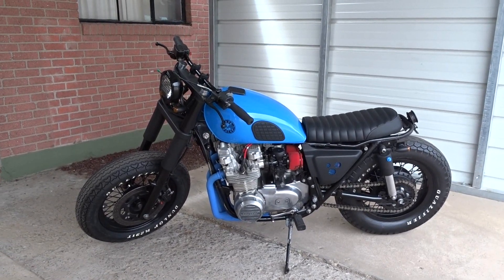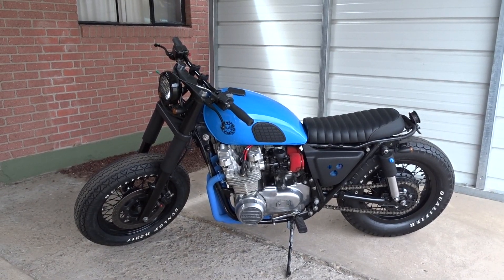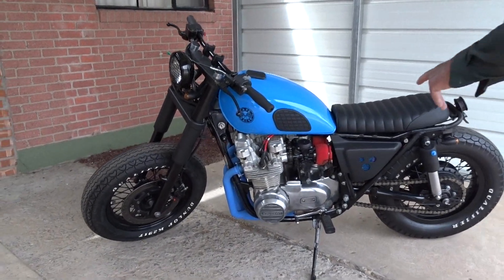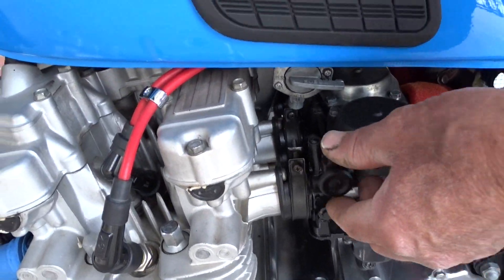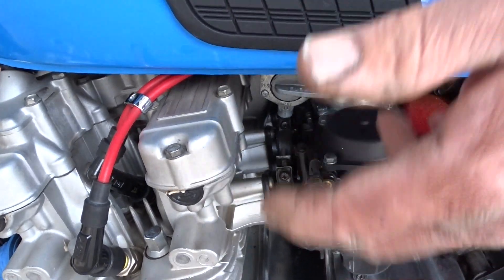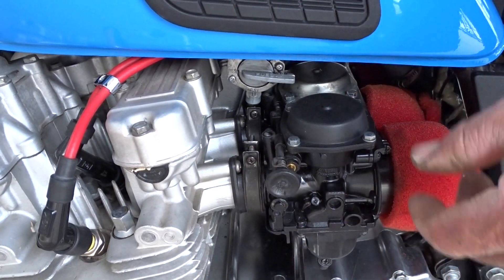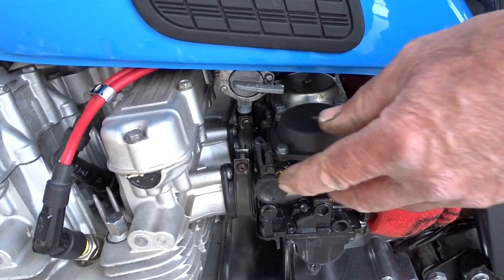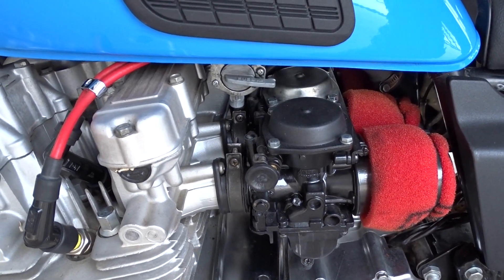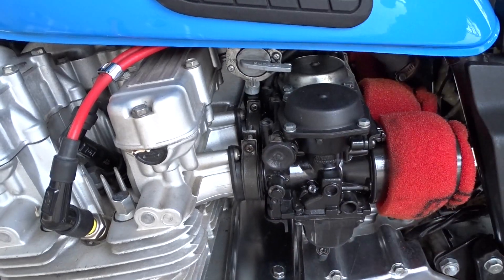Just wheeled the bike out for a cold start, and we'll go over where everything is that we didn't cover in the video — the video was just for the bike's performance. Here's your choke knob. When starting cold, pull it all the way out. You'll hear it rev up and then start to idle down. Push it halfway in, let it idle for a while, and when you hear it idling higher, push it all the way in — you're pretty much warmed up.